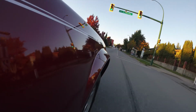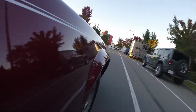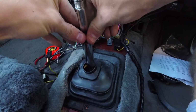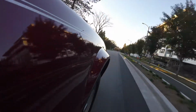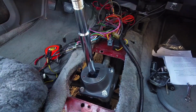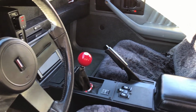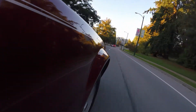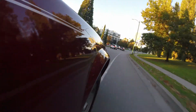That's the other big difference, sound. Because the shifter does not seal very well against the boot, there's gonna be more road noises entering the cabin, especially if there wasn't a rubber grommet in place like I put on. Additionally, because the shifter is now purely metal with no rubber to isolate vibrations, you can actually hear the gears of the transmission spinning through the shifter. I personally think it's a pretty cool noise, but some would disagree, and unfortunately it's a hard noise to record. But if you do this mod and start hearing weird noises, it could very likely just be that.